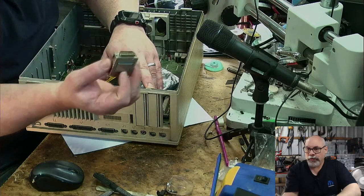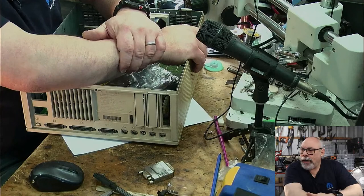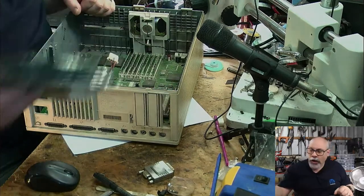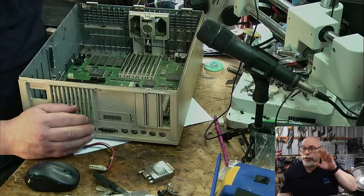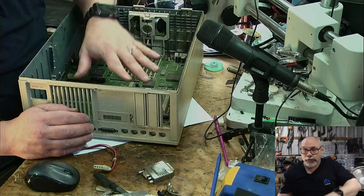So this is just like my 2CI one. Boom, boom. Right, okay, so yeah, the light turns on. Okay, that's what I would expect. Okay, all right, so anyhow, obviously it needs recapping, I would say. The one good thing is if the light turns on, you know the startup circuit works, and that's one of the problems that often happens with these 2CIs.